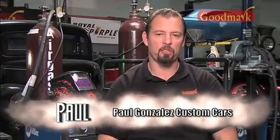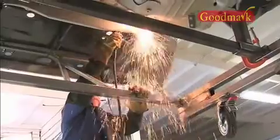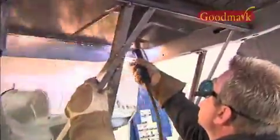We made great progress on the suspension installation today. Did the prep work on the car to fit up the main support frame and the rear suspension. We had to remove the upper brace that runs side to side, which is the shock absorber mount brace. So Dan got in there with the plasma cutter and cut the bulk of it out, then we went back with drills, cut the spot welds out, and chiseled the remaining pieces out of there.